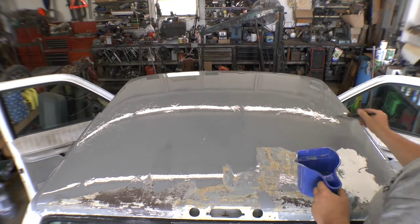I went home for the night, but I'm back in the garage this morning — let's take a look and see what we've got. It is glossier than I thought it would be, but it covered everything pretty good. It didn't self-level as well as I would have liked, but when we prime and sand it, it'll be just fine. The good news is I just don't think it's going to rust anymore. I'll put some primer on it and put the trim pieces back in. So there we go — the top of the truck has been coated in POR-15, and that should stop the rust situation.